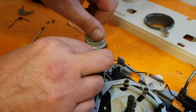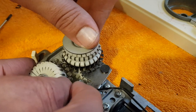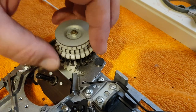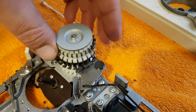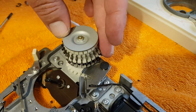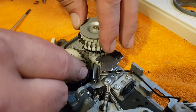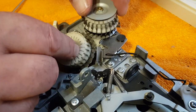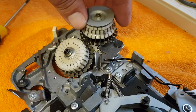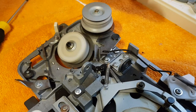Back to where it was. You can see it won't go down because the pins are up. All you're going to do is work around to the front — there's the gap that you need — and very gently push the pins back up, and that will hold it in place. Now this should hopefully spin nicely, just like the way it should.